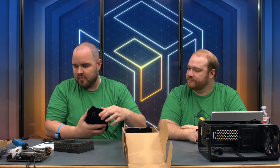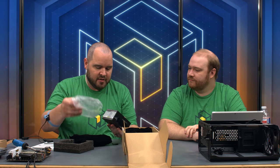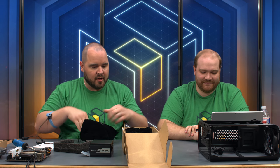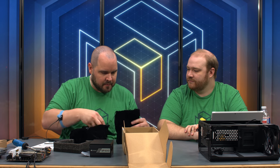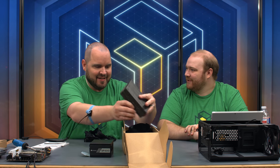Inside the box you've got warranties, a manual, accessories with zip ties and screws, and then the little baby power supply. We'll need a 24-pin, an 8-pin EPS, and an 8-pin and a 6-pin PCIe for the 1080 Ti. Thankfully no SATA, no Molex. Everything is labeled on the cables — just match it up and push it in until you hear a click.